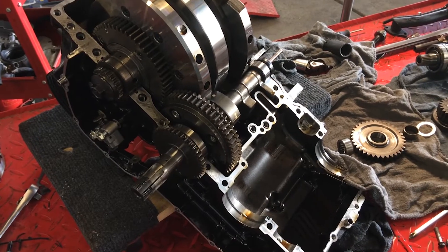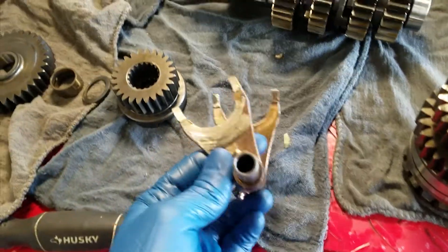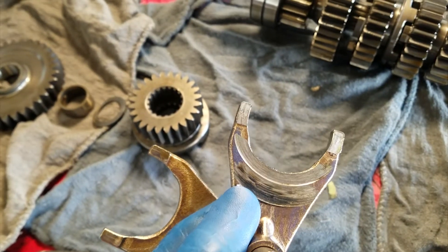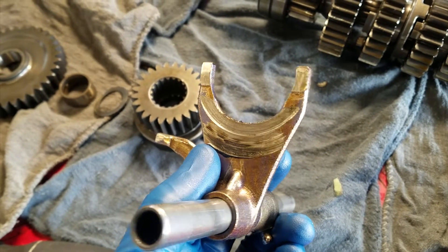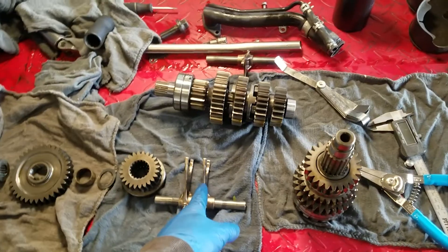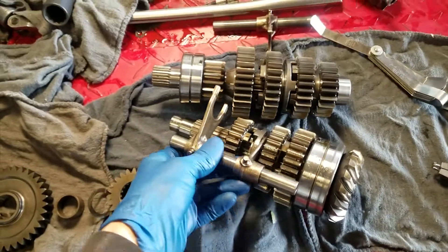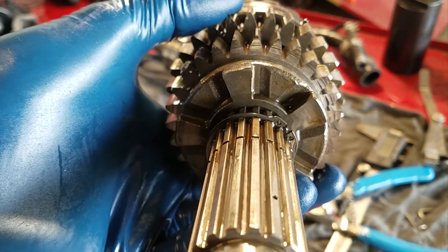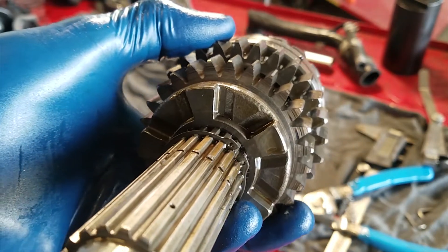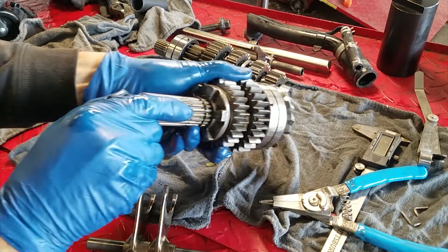In this case I'm diagnosing that Suzuki M109 that I pulled apart the other day — I cracked the case open, we've got it all laid out here. The first thing I noticed when we pulled this apart is a really damaged shift fork. Obviously we can't have any of this. Because this is jacked up, the gear that it rides in is going to be jacked up too — see that scarring? Not good at all. Bad, bad, bad — we're gonna have to change this one for sure.